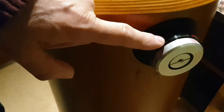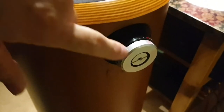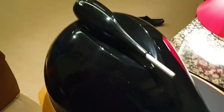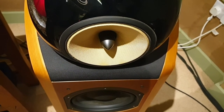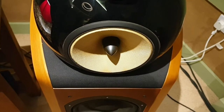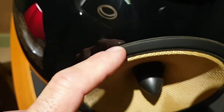On the back is a nicely made aluminium piece. This screw holds the driver in place by means of a bolt that attaches to the back of the magnet — just a threaded bar with a nut device on the back. You tighten it up and it holds the driver in place. The drivers are mounted in a jelly gasket made of silicone material, which is ultra squidgy — it feels like jelly. If you look very carefully, you can just see it oozing out on the perimeter there.